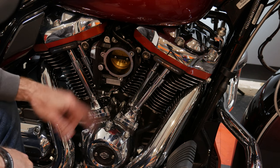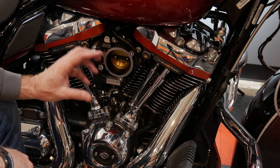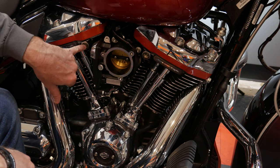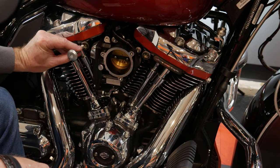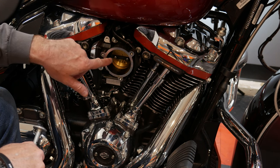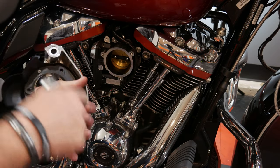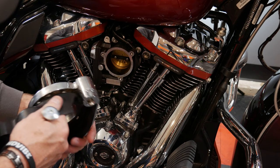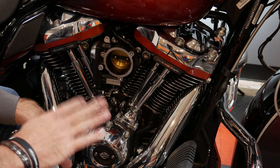If you get the Screaming Eagle kit directly from Harley-Davidson or a complete kit from eBay or the aftermarket, you will need actual breather bolts for these two ports. These T45 bolts will not work with the ventilator kit because you actually need hoses that will hook up and go into this breather. The way this is routed, the blow-by comes in through the ventilator into the housing differently than with the heavy breather. So that's a key tip — if you don't have those breather bolts, this is not going to work.